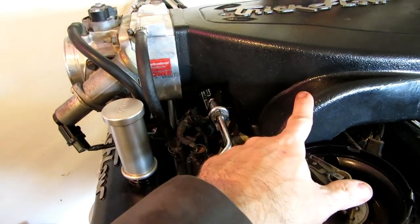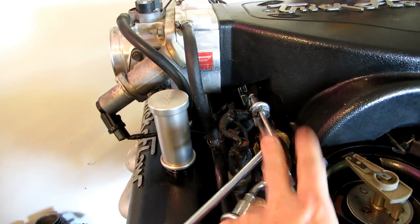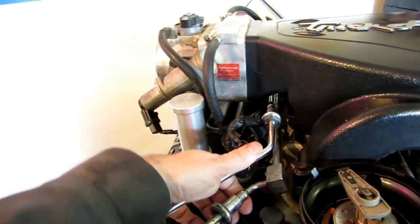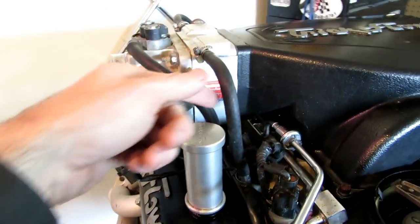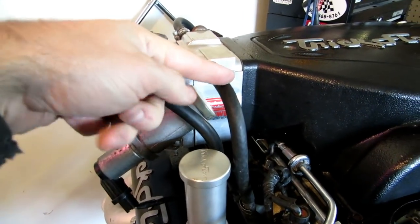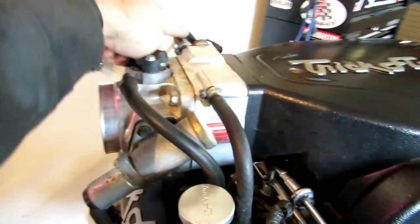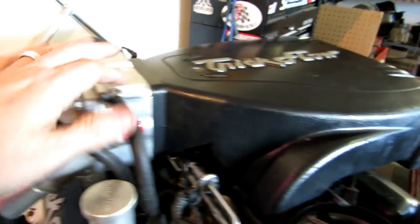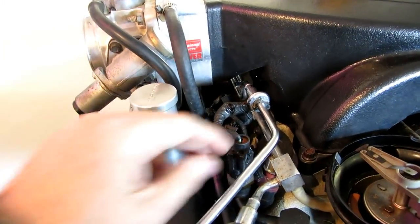To take it off both engines, I had to remove the upper intake — it's already removed on the 86 — and also remove the fuel rail on the passenger side to lift it up enough to get it in place. Now it's installed correctly, the bracket is screwed down, and the bypass is installed correctly. It previously had just a plug block-off, so now we've got the correct heater loop going through the EGR block.